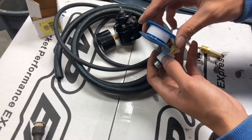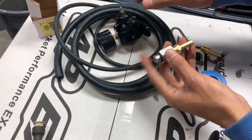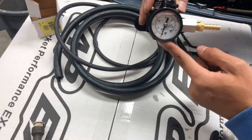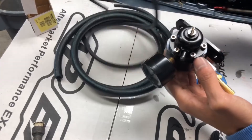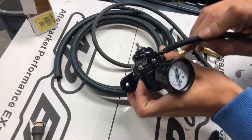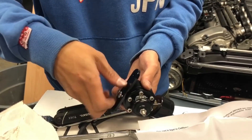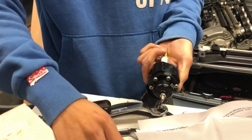These are the fittings that we will be attaching onto the fuel pressure regulator. We will be adding Teflon tape between the silver and the gold colored fitting. It is important that we have these tight on both the left side, the right side, and the bottom. On the top there is another fitting to attach a hose, which will be connected to the engine vacuum to read the amount of engine load and adjust the amount of fuel entering the engine ever so slightly.